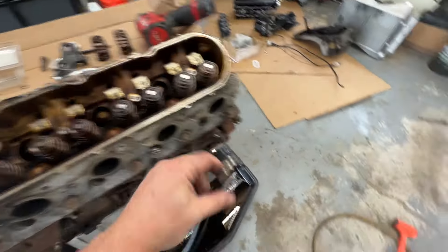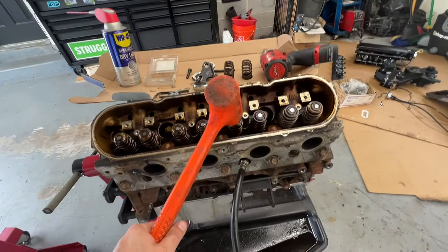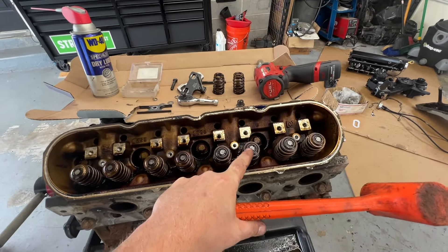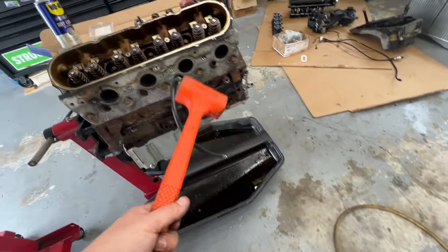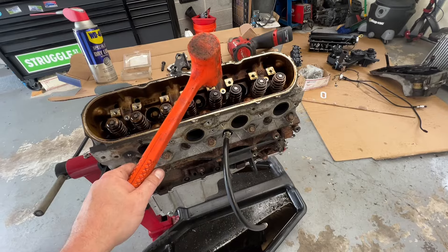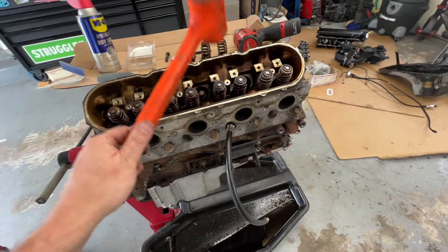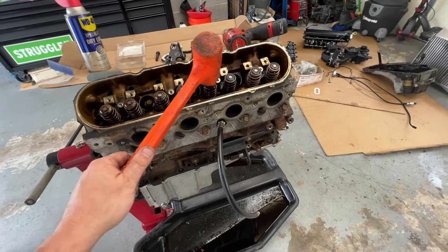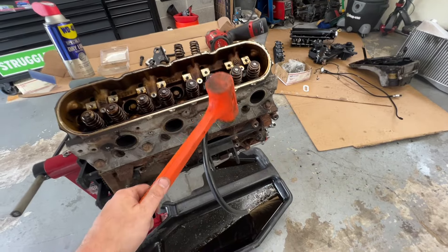This is in all the way. Here's an important step: you connect the air, and then what I like to do is give the valve stems a beating, because these get all crusty. When you go to push your spring compressor down, it just pushes the valves because they won't break loose. So I'll hook up air. You will usually hear a leak because people complain about these being so pitted. When you hook up air and smack the exhaust valve, it'll be pissing out of both ends, and you pound the exhaust valve and it seats because it has the pressure.